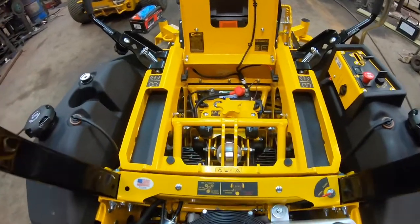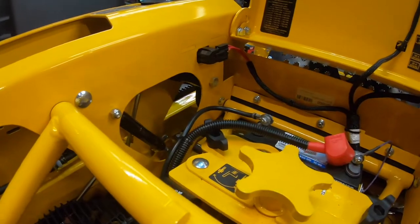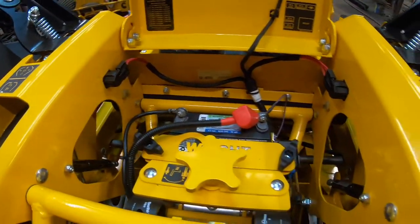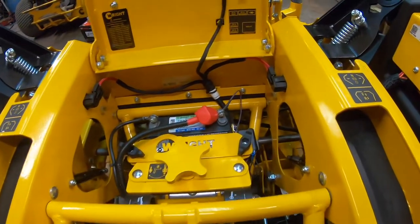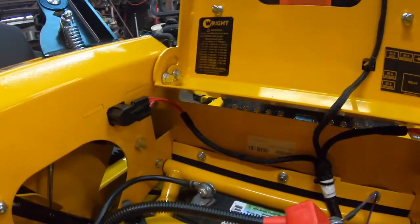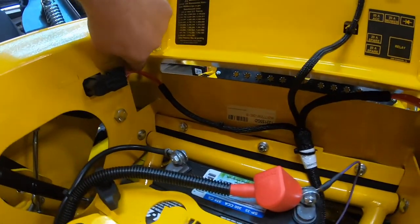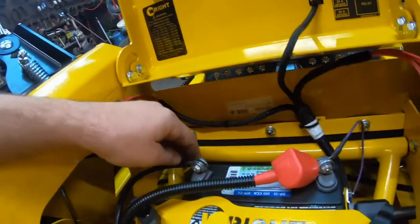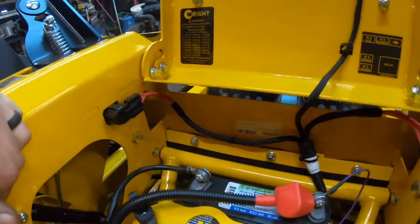All right guys, here you have it. I've got it mounted. I've got a little piece of three-sixteenths stock right there. It's tightened up and those things are angling exactly where I need them to. Let me figure out what I'm going to do with the wiring. And isn't that super clean under there? That's going to be really easy to get to. I'll probably route my wire right down through here — maybe zip tie to the frame somewhere. Just want to be mindful of anything that's going to be moving in here. But I think this is going to be super easy to get to. Could probably even route it out right through there, come in clean, zip tie to one of these wires, and I've got my negative and my positive all easy to get to.